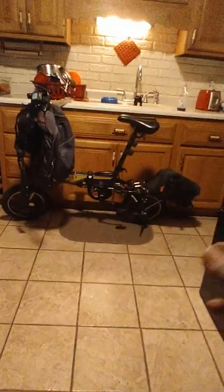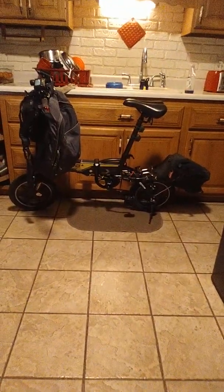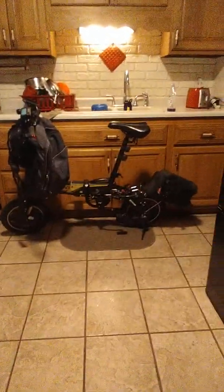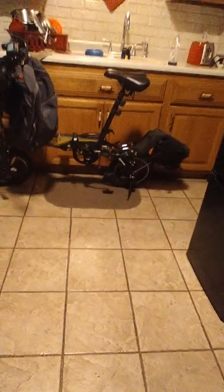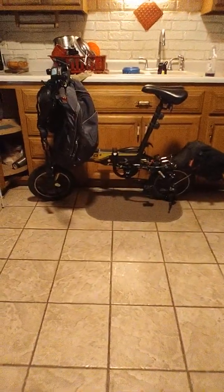I'm definitely using half the power in amp hours that the other scooter was using. That's very good information for those of you who want an efficient, long-range vehicle. A 20 amp hour battery is considered large by any account on any e-bike — it doesn't matter if it's a 500-watt geared hub motor. Imagine having a 20 amp hour battery on a 250-watt geared hub motor, over-volted to 48 volts — it jumps all the way up to like 730 to 750 watts using the Base Runner with the Bafang G310 motor profile. Smaller can be better.